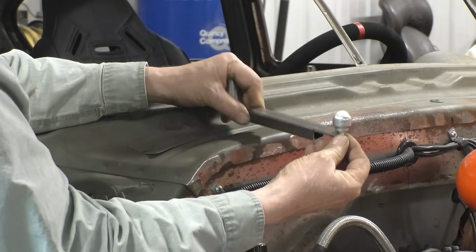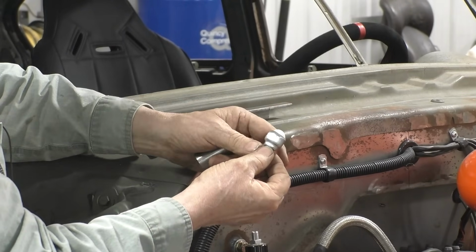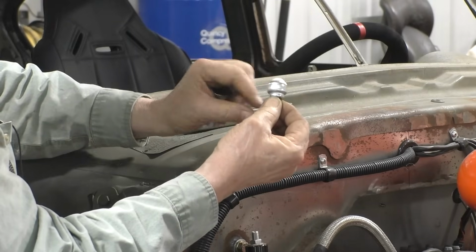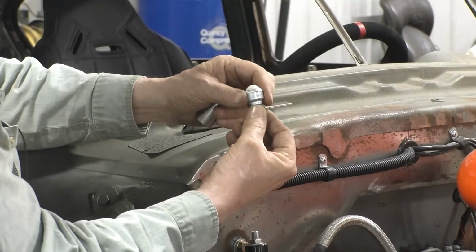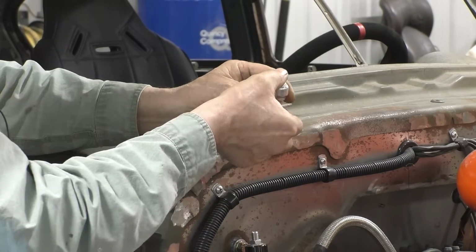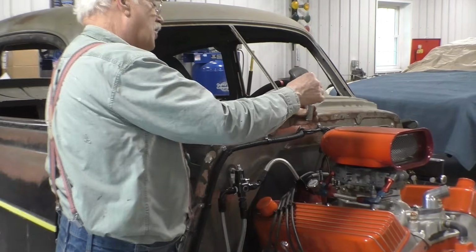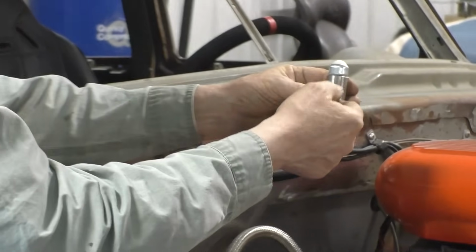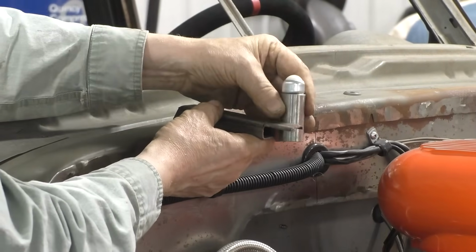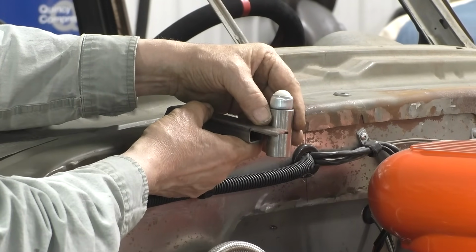And the Hudson bearing only works, in this case, because I bought cheap Hudson bearings, if you have tension on the bolt. If you pull down on the bolt, the ball runs fine. But if you push up on the bolt, the ball doesn't roll. And that's how it's going to be if I just bolt it in. So we're going to put a sleeve on the bottom of our Hudson bearing, the right length, so that when this is up here, we can pull down on that Hudson bearing, and that'll keep that ball rolling.